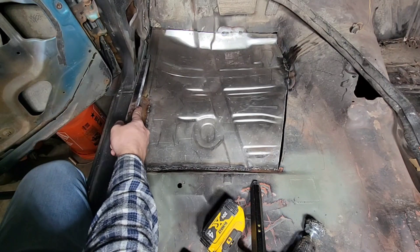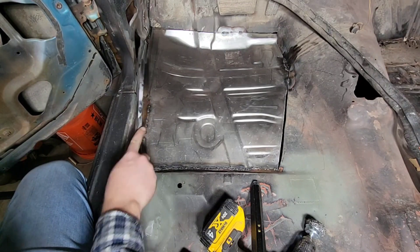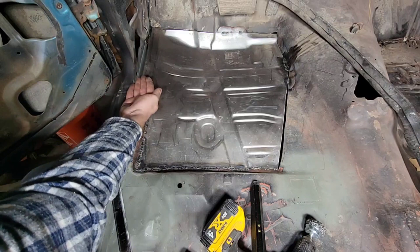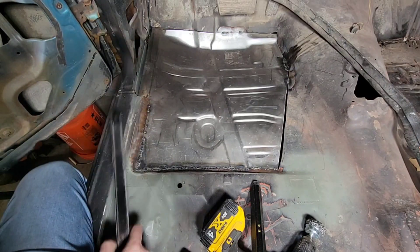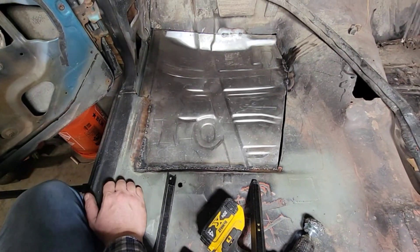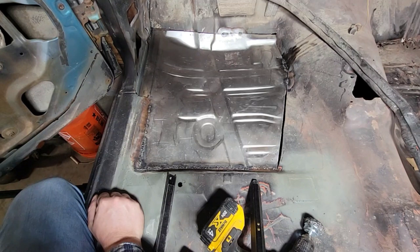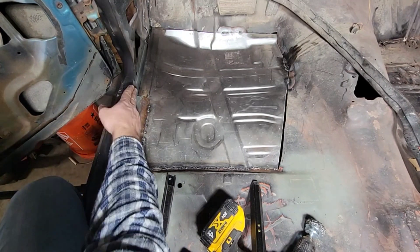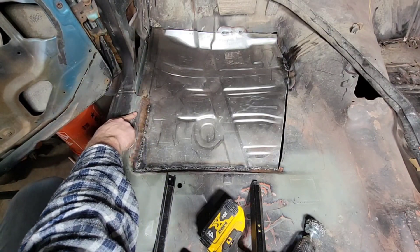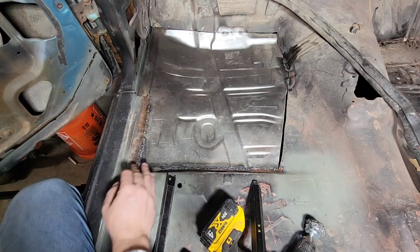This side when I cut it out had a little lip that came down off of this piece and went over top of this, and then it looked like the floorboard itself had another opposite piece on the bottom — like a shelf — that welded on the inner rocker, and then the pan set on that. Since all 97,000 layers of my metal in here were rusted out I had to make each one myself. I didn't want to make those shelf pieces until I got the pan in so I could see where it needed to sit. I'm gonna craft just a little piece with a 90-degree bend on it, weld it in there, then cap this side off.